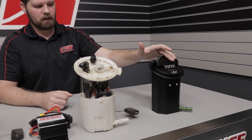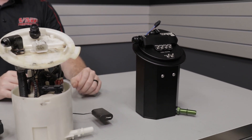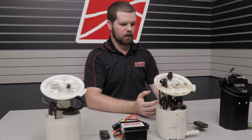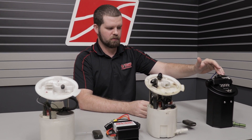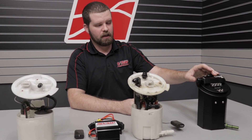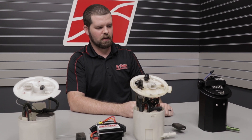All the way to the right here is going to be the ultimate and final solution — not necessarily this brand, but a return-style fuel system hat that's dedicated for ultimate fuel flow instead of a factory-style setup that's been made to work at higher levels. This example right here has two of the Walbro 274 model pumps, which are 465 liter-per-hour high-pressure pumps. The twin 274s we've done on cars as high as 1100 wheel. We could probably get a little bit more out of them, but in situations like that I'd recommend a third pump or two 525s instead of the twin 465s.